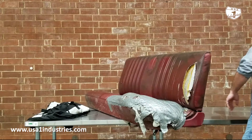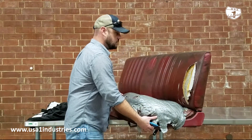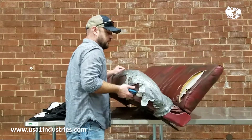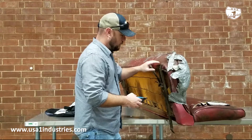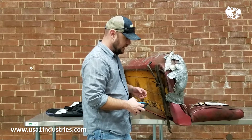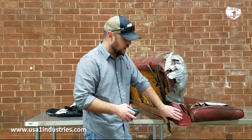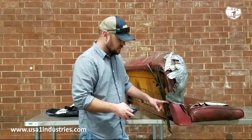There are all different types of tools you can use to actually get the seat cover off. We've got these handy little cutters right here. I will take the seat tracks off first — those are very simple, just standard hex head bolts. Then I will also take off the hinge covers right here; they are also just a standard Phillips head screwdriver.